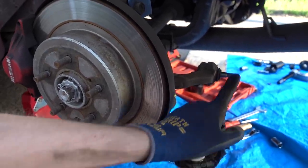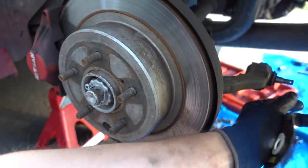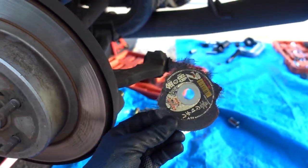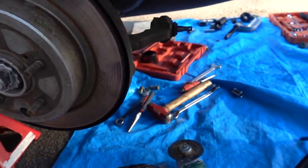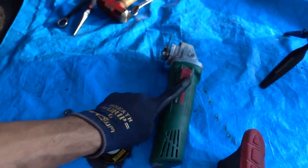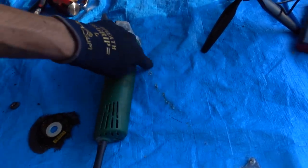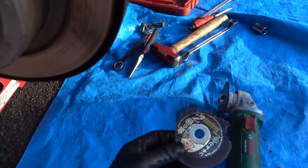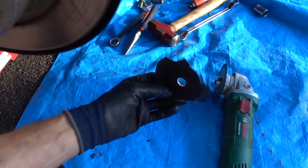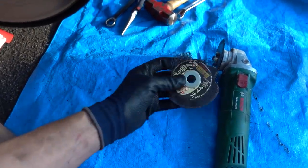It's time to get this side sorted out. The first step is we've got to cut this off from the ball joint, because with the press and everything this sticks out too far, so we just chop it off so the whole thing can fall out. Now, I just had a pretty scary thing happen with my angle grinder - I tripped over the extension lead, which caused the switch to turn on and the angle grinder powered up. It nearly took out my GoPro and cut the tarp. Always be careful with power tools - I'm just going to always unplug it when I'm not using it.